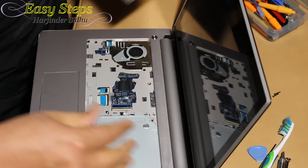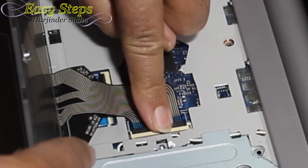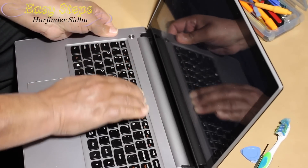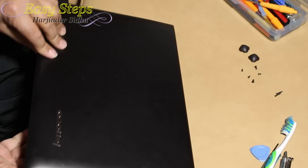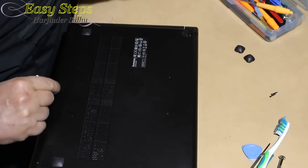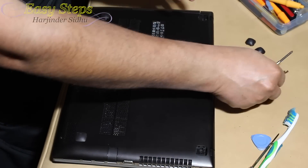Once all the screws are tightened, place the keyboard. It's important — insert the ribbon cable, then put the lock back in. Same thing on the other side — don't force it, just press it down and it locks in. Insert the keyboard tabs on top and press down on the sides as well — it locks in. Now close the laptop and go to the back. The three small tiny screws go in the front, and the two longer ones go in their holes. The longer screws go in the middle.